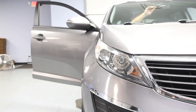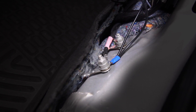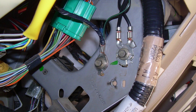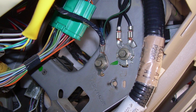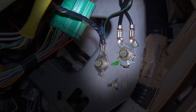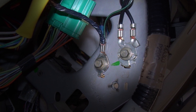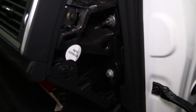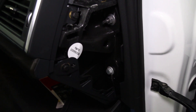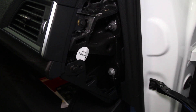Now let's discuss the best type of ground points. The best type of ground points are the existing factory points on your vehicle. Factory ground point locations vary by manufacturer, but they tend to look like bolts or metal studs. For example, in some vehicles you can locate a metal bolt or stud by your glove box or behind a removable panel on either the driver or passenger side of your vehicle. After finding a factory ground point, make sure to check that the point is bare metal. If there's an interrupting coating on your factory ground point, you have the option of sanding off the paint and/or rust. You can also search your vehicle for another ground point if the point you located isn't conductive due to rust or paint.